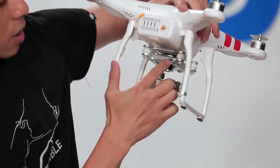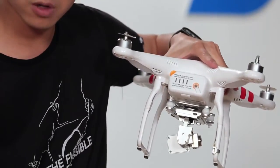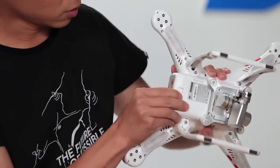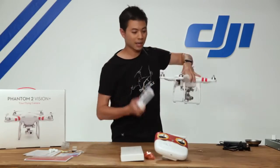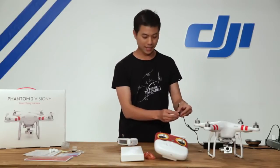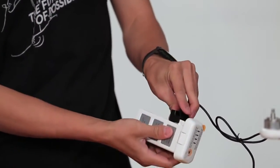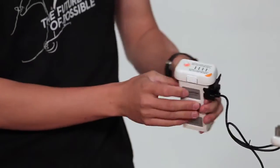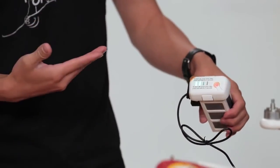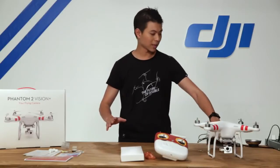You're also going to find a USB port on top of the gimbal. You can connect this to your Mac or PC to download your photos and videos. Let's go ahead and take your battery out by pressing and holding the tabs on the top and bottom and pulling. To charge the battery, open up the tab on the charger — you'll see two prongs — and on the battery you'll see two ports. Simply connect them together; there's only one way so you can't go wrong. You'll see the battery lights flashing: three means you're at 75%, four means 100%, and once it's completely full the lights will stop illuminating altogether.